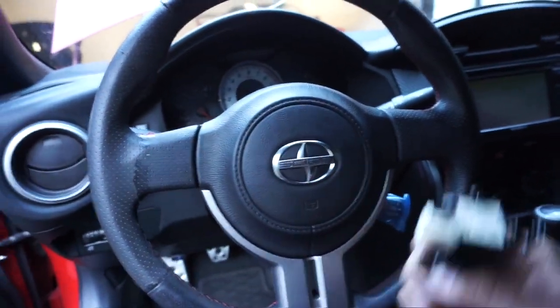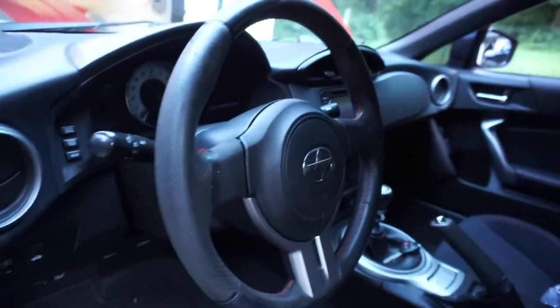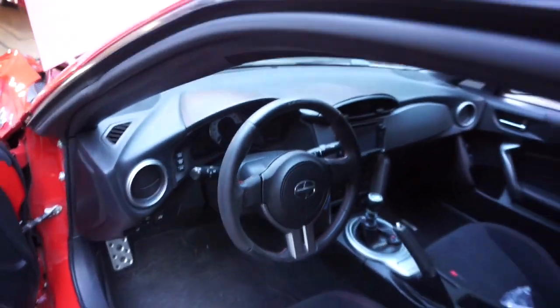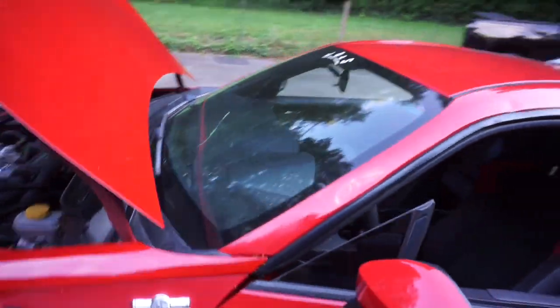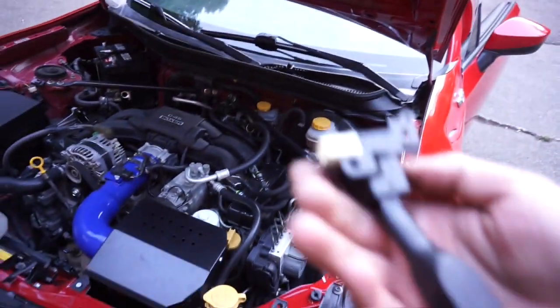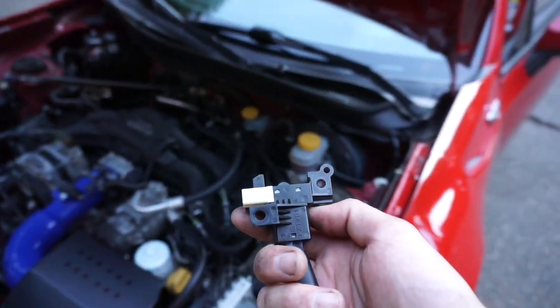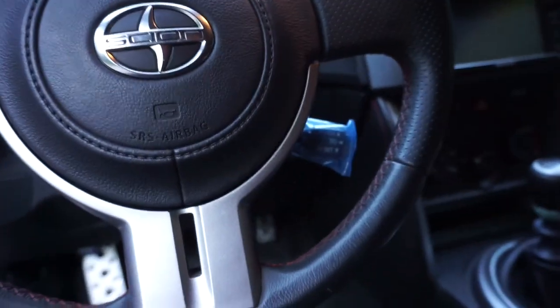So we're going to discard the old part — we don't need it anymore. We do have a key in. Let's turn the key off real quick — I had it in to align the steering wheel. I will be removing the steering wheel later. I might go with the carbon fiber, but I definitely want a flat bottom steering wheel, so we'll be doing that later. I'm going to be doing a lot of mods. The first thing we really should be doing on this is probably fixing the exterior body, maybe doing a body kit, and then putting a new clutch in. Then we'll do power mods and small stuff. I just wanted to get the airbag, horn, and cruise control working. Battery connected — let's see if we fixed this. This could be your issue if your cruise control is not working — that little switch does wear out.